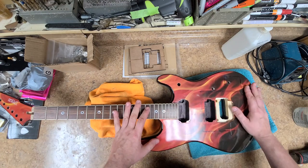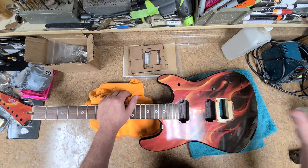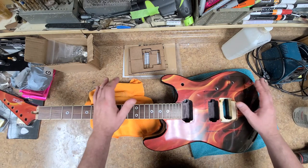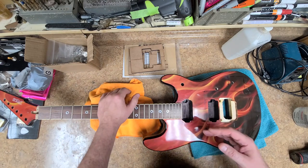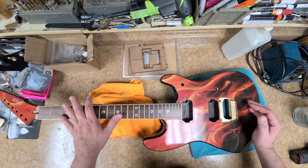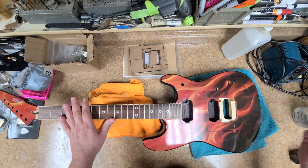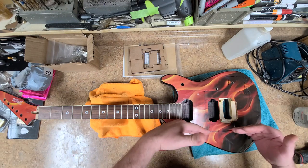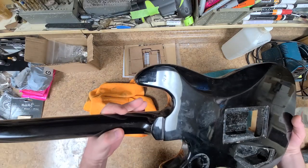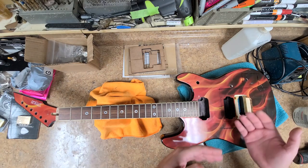What I'm going to do is strip the body, fix any dents and chips, hit it with primer, wet sand that down, then hit it with white — because the body is going to be mostly red, and white makes it a lot easier to stripe. I'll spray the body white, lay down my striping tape, spray down the red, then peel up the tape and do the black, then peel up all the paint tape and get into clear coating. It's real simple and keeps you from doing more work than you have to.